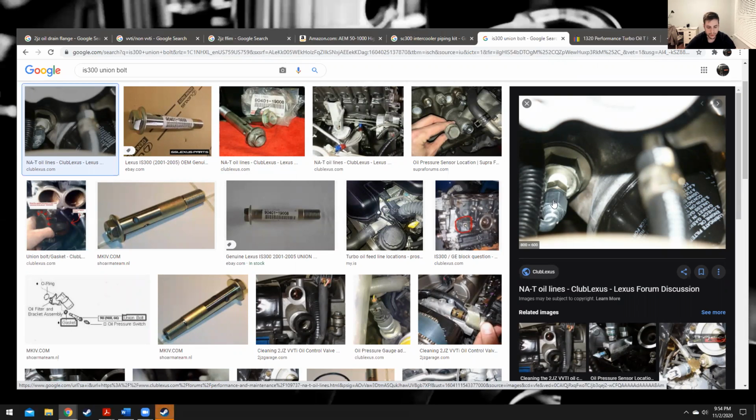Let's see if we've got any of the notes here. Yeah, you'll need fuel injectors, right? So you will need some 440 cc is what the JDM Aristo is expecting. High impedance, top feed. There's a lot of those online you can find. I bought mine from Oside Tiger, and they came with these adapters to fit the existing harness.